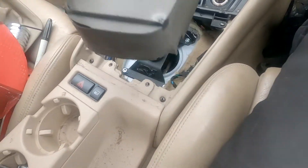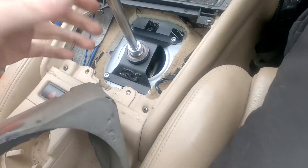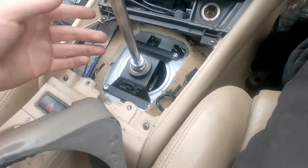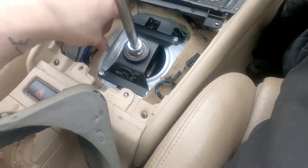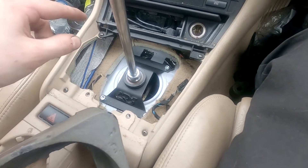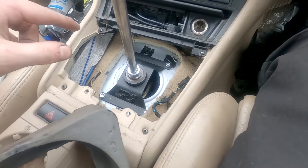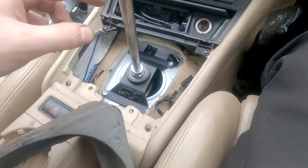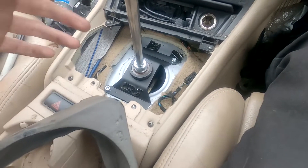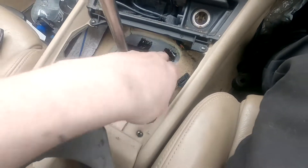I'll just pull this foam piece up — I wanted to see if it fit, because without it it's quite loud, which doesn't really bother me since it'll be a weekend car anyway, but I'd prefer a little bit of sound deadening. It's all bolted in, all the bolts went in fine. I did oversize the holes because they're M6 bolts — so a 6mm hole, I put them to 7mm or 6.5mm — I just made them a little bit bigger with a bigger drill bit, which made it easier for them to go in.